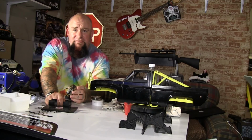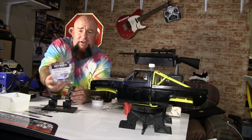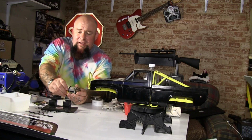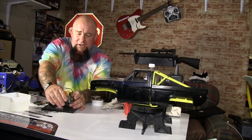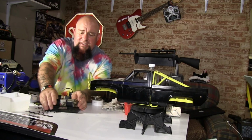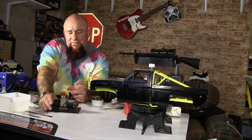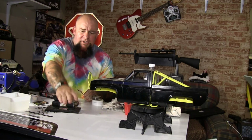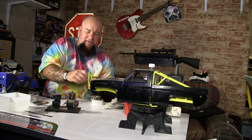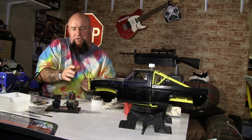The motor I'm going to use for tonight's demonstration is another Energy 35 turn, brand new in the package. Brush motor. It's 35 turn by 1 wind, means it's not super fast, and the 1 wind gives it lots of torque. I won't go too much into details on the motor turns and winds, because that'll vary from user to user and what you're using it for.